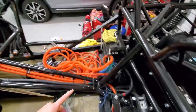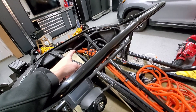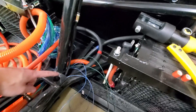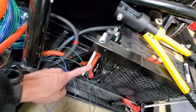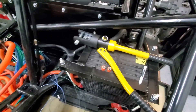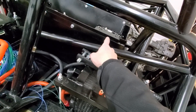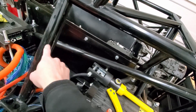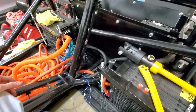I'll describe how this goes: the zero voltage — or negative, whatever you want to call it — goes to the front battery pack, going through modules one, two, three, four, with positives coming out from module four. Then down to the negative — I'll call that module five — up to six, and six will go into the high voltage box that'll live behind here. On the back, the ground or lowest voltage goes from there through one, two, three, four, over to five, six, and then over to the HV box. That's the plan — I'll start cutting all the orange cables and getting everything set.